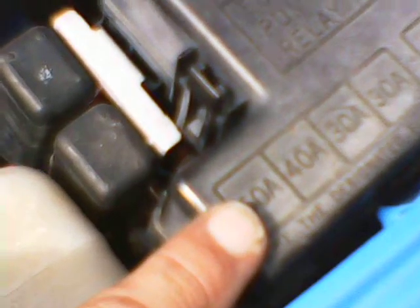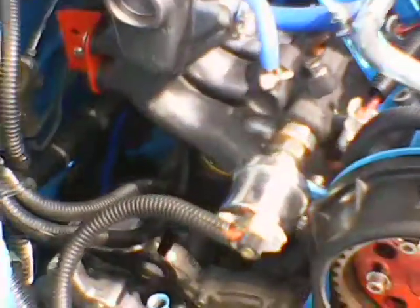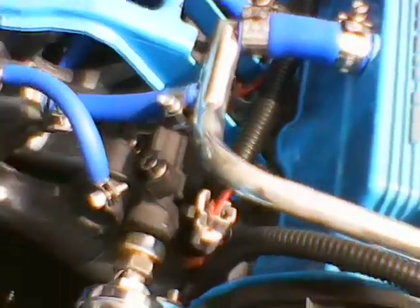The fuse position would be right here — this one marked 60 amps. That's the size fuse in cars that have the 55-amp alternator. That's a problem because if I'm making 105 amps and it's fused at 60, there's a possibility it will think it's overcharging and clear that fuse, which would be a problem.